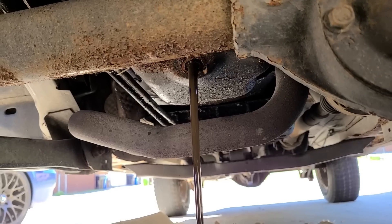Here's our first shift — perfect, we're in second. It shifted. Coming to a stop — doesn't shake, nothing. The alignment is way off though. Here's that 1-to-2 again: mint. 2-to-3: perfect, we're in third gear. The steering wheel is way off, but that's okay. And there we go — it shifted again. It's so nice, buttery smooth. We still have a lot of bad fuel in here, so this thing I guess could run better although it's pretty much perfect right now. This transmission is perfect — I checked the fluid and it looked really nice and clean, the level was correct.